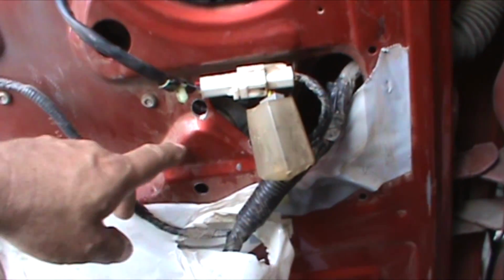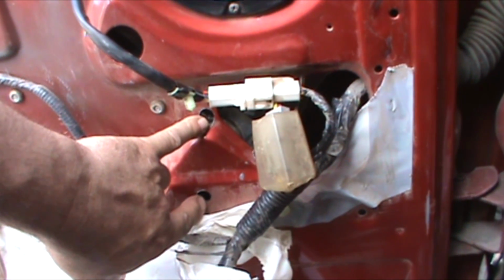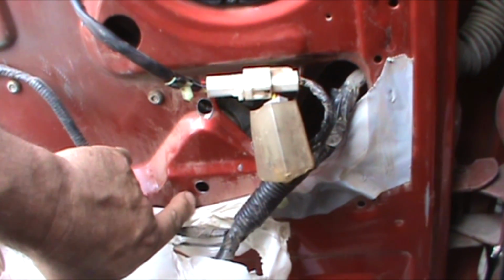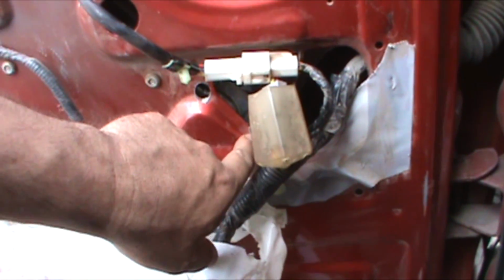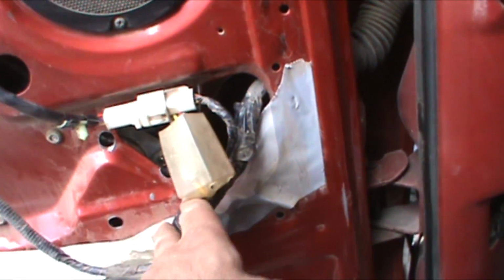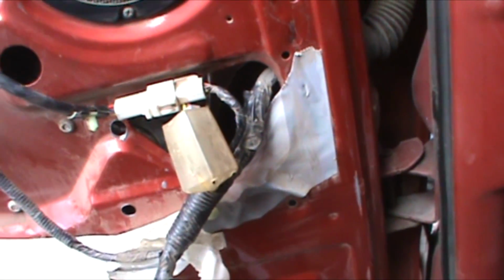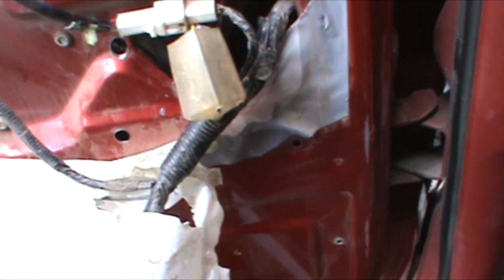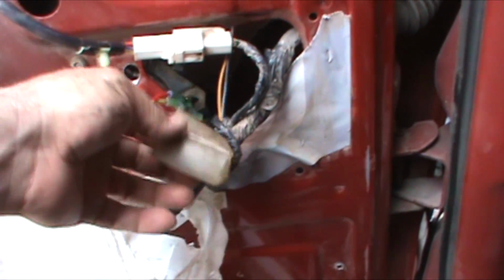Biggest thing on these old trucks, this was actually an original motor because these holes have never been drilled out. The first time you do them, there's little dimples, you got to drill them out. These two, this one's kind of accessible, but I had a little burring tool and just opened it up here. Three bolts, it drops out, one plug. Not worth dealing with the interruptions. Let's just try to film that. It's pretty simple. So we're plugged in.